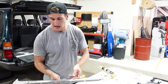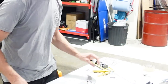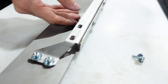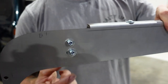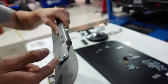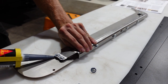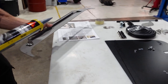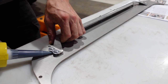We've got all of our mounting hardware in there now, just loose. Before you tighten everything down, grab your mastic sealer — the Sikaflex 255 — and put some sealer in between these outside mounting faces. The reason is there are slotted holes, so there's a little bit of an air gap, and when water comes in it may slip through there even once it's tightened. Put a bit of sealant in there to prevent that. A little bit of this stuff goes a long way — it will mush out the sides.